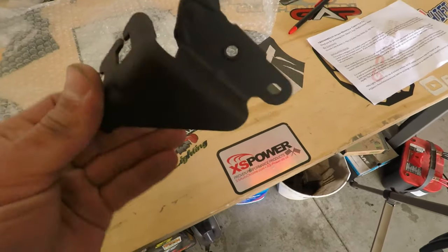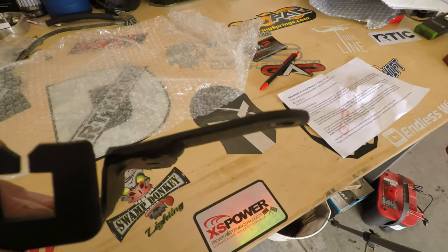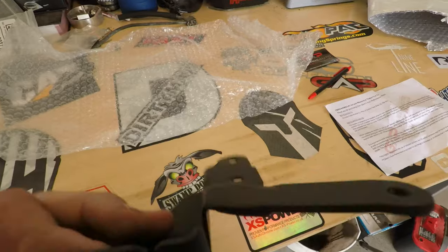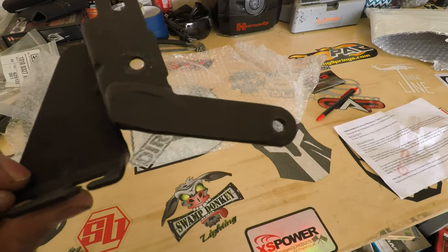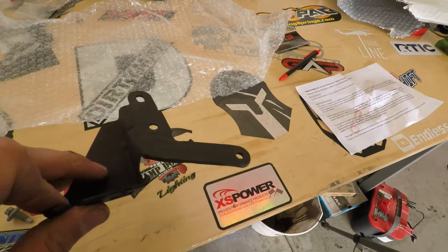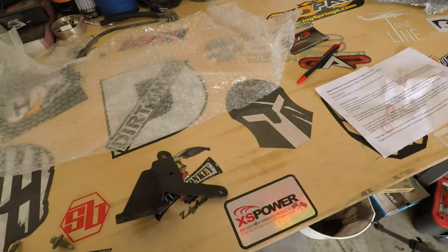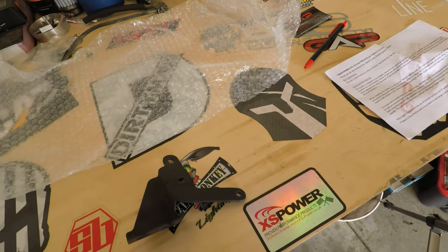Here is the factory bracket off the truck. I had to kind of just guess, bend up, bend down, whatever — then put some vice grips on it to where I liked it, take it off, get it welded, and then paint it. But like I said, it was kind of just a band-aid deal. It was only good for so long. Once I adjusted the throttle body, I had slack on the pedal, and now it is nice and firm the whole way through. So there's no delay when you hit the gas.